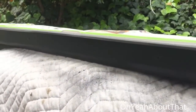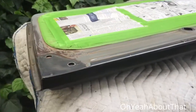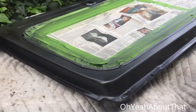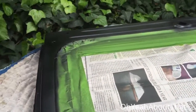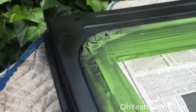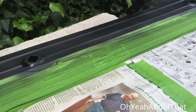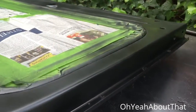I've got it all primed and unfortunately I'm out of primer. I am going to have to get some high build primer at the store. It hit these areas where the paint was all wrinkled — I'll sand those down and this thing will be good. I'm not going for perfection here; that's why I'm painting with the rattle can.